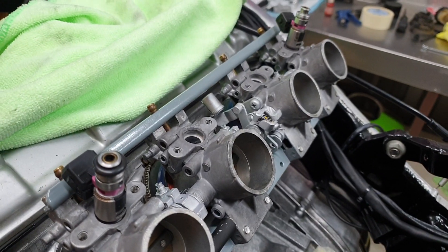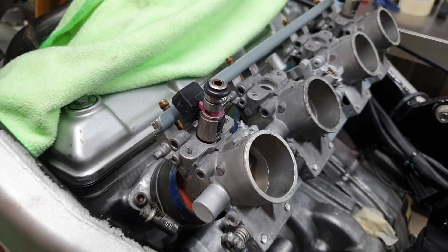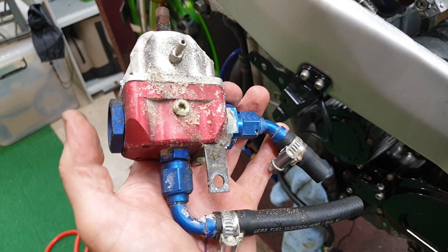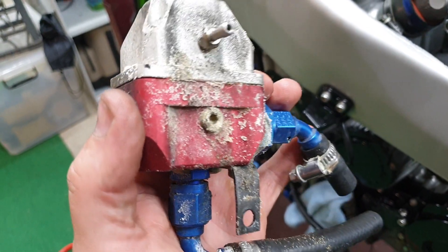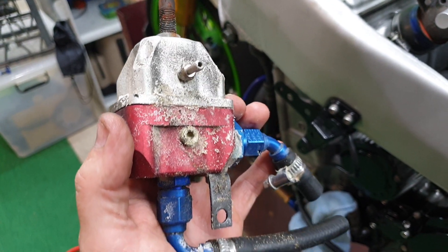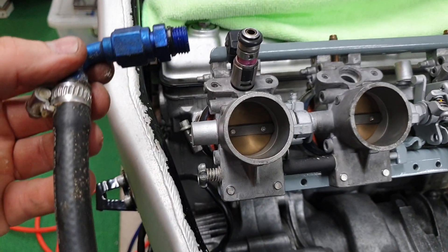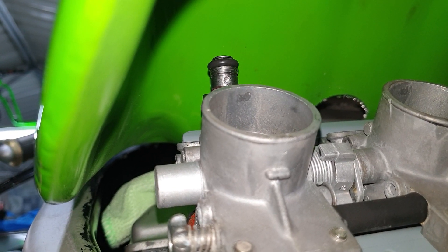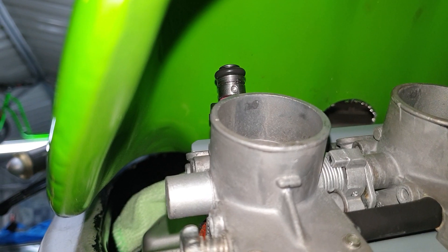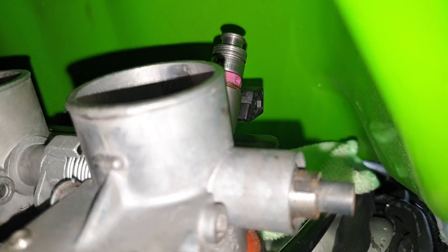Before I order the fuel rail I need to make sure I've got enough clearance for the fuel lines to enter it from either end without hitting inside the fuel tank. I'm going to borrow a set of special fittings off this regulator — it's pretty scabbed out, so I'll steal this bottom one and tidy it up before putting it back. I'll knock this fitting out and try to figure out if I've got clearance. With the fuel line fitting borrowed from my regulator, I can see there's no way a fuel rail with these style fittings will fit within the limits of the frame rails. I need to keep the fuel rail as compact as possible to give me the most options when fitting the fuel line — the right-hand side isn't quite as bad, but I'll keep it tight as well.